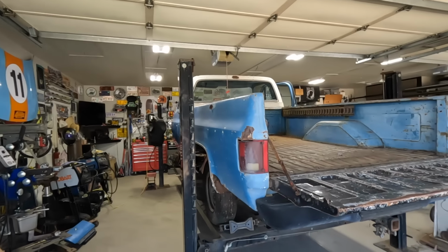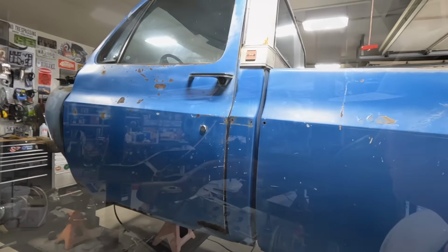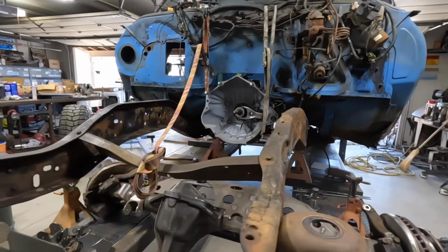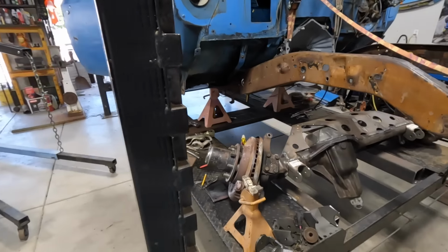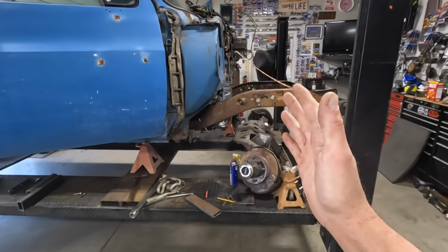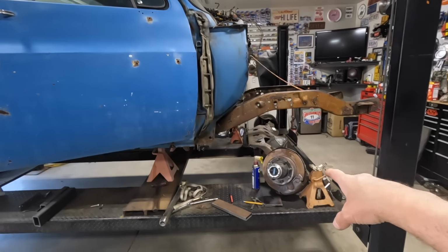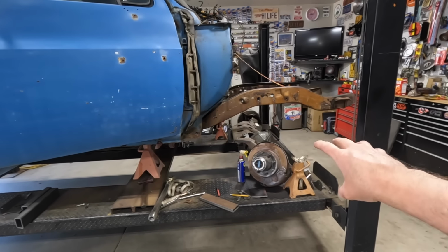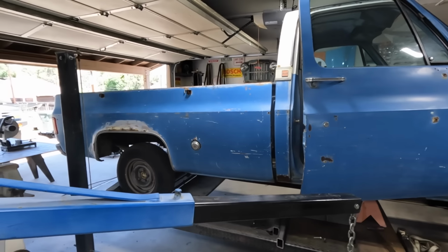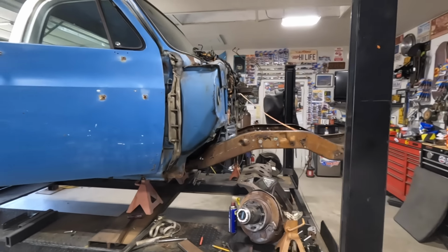Right now we're going to go ahead and go through this project and figure out the starting point. I think first things first is probably getting this front axle positioned back sort of where it would have been, and get that back on jack stands just to figure out spacing, like how much we're going to stretch the wheelbase so that we don't have to tub the firewall. We're going to try and get the axle into place and then figure out some sort of arbitrary wheelbase number that we're going to shoot for. And then it's go time. Then it's time to start cutting on this thing.